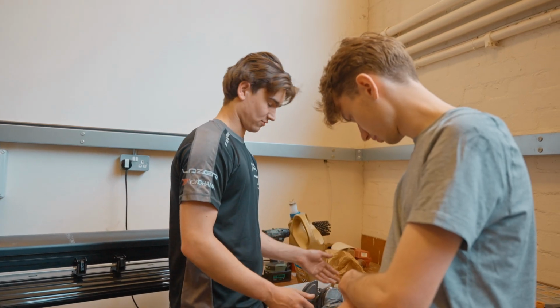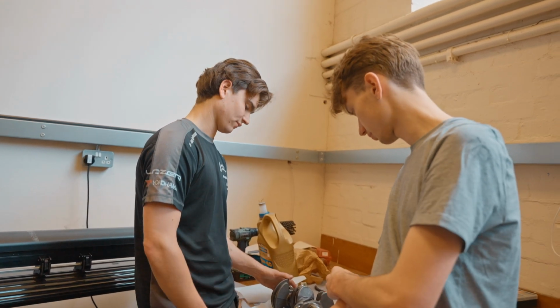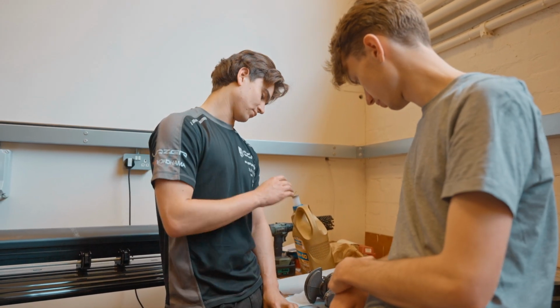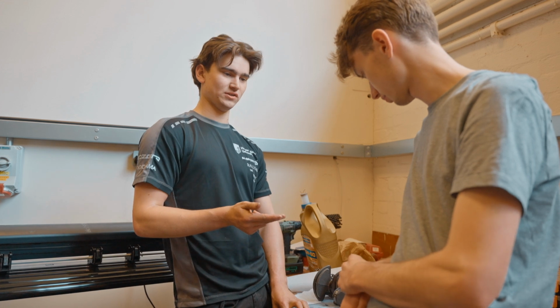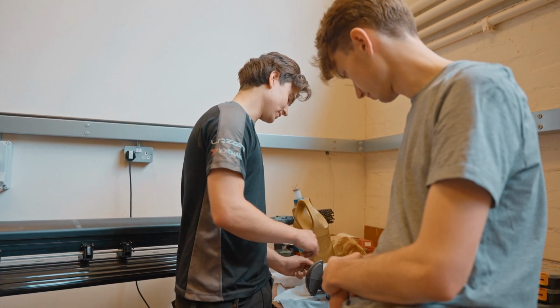Examining your parts, like your cranks, and if you have your rods, for example, crack testing your rods and all that sort of stuff that you want to do way before you actually get your engine on the stand and start putting it together. We probably do a day of cleaning, a day for stripping, and then pretty much another day or half a day of purely just inspection of bits. That's just how it is. There's no way around it.